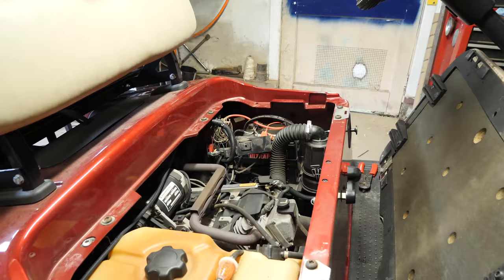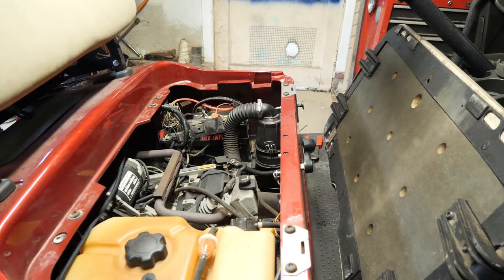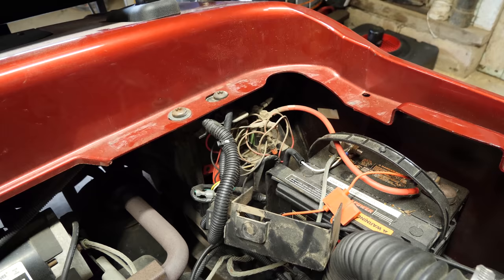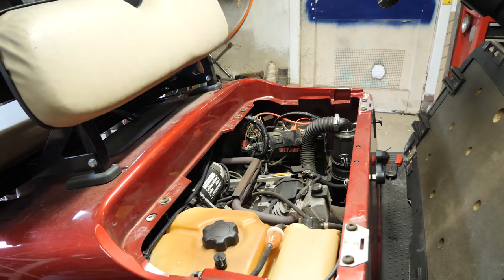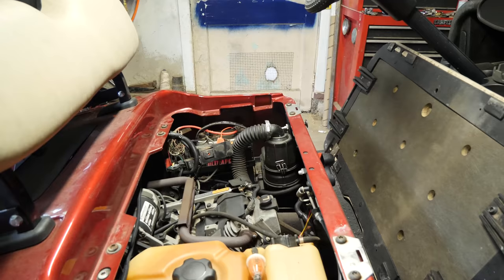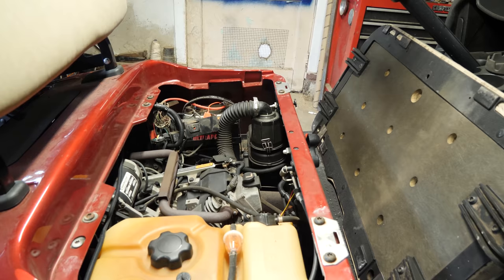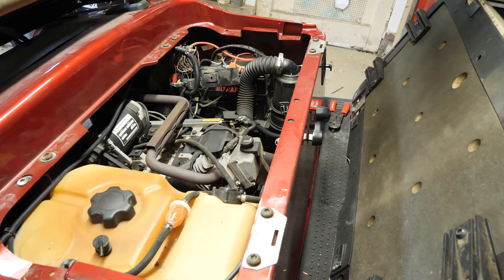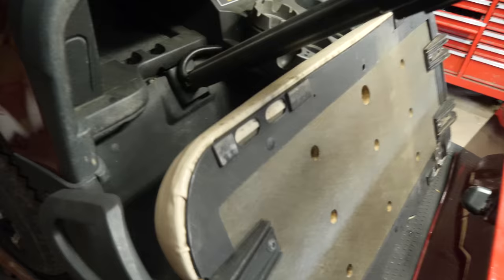I've been kind of messing around with it a little bit. I haven't really done much to it yet other than put it up on the ramps, take the seat off, set the light up, and pop off this cover here that covers the solenoid and voltage regulator. What I'm experiencing with a lot of these EZGOs — and just to be clear, it's not on every single one — it's a sporadic few, and I think it has a lot to do with the light kit. After the cart sits for a while, there's something draining the battery completely flat dead. You go to try to start the cart, turn the lights on, and nothing works. So we have a parasitic draw on this cart. We've got to figure out what it is.